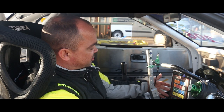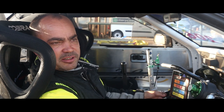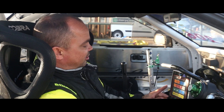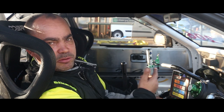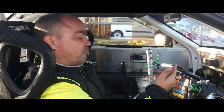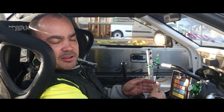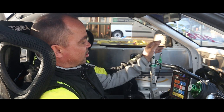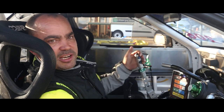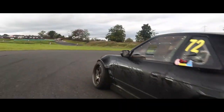Hydro has two master cylinders. The top master cylinder is for front brakes, and the bottom master cylinder is rear brakes. The top master cylinder actually goes to a remote servo with a vacuum, and so the front master cylinder is actually then servoed front brakes. So push that, you'd have servoed front brakes. Pull this, and that's just the same as any other conventional hydro.